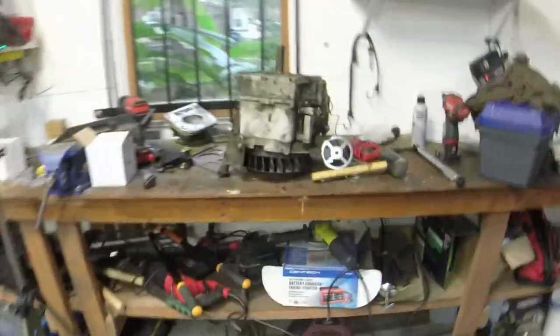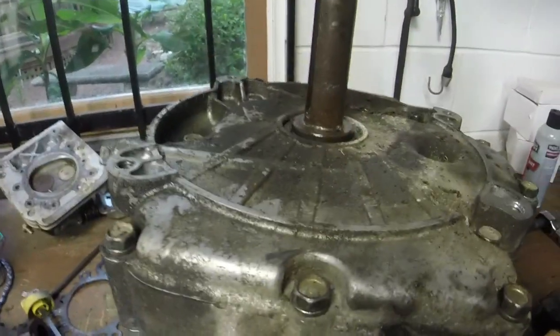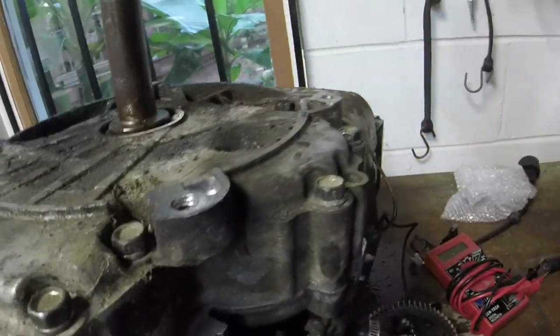All right, guys, so I did what I told you I was going to do. You just get the eight. Make sure the governor stays on that arm. Slide it slowly down. Make sure that your seal is good around your bolts, or around your sump, whenever you set it down. You can tap it with a little rubber mallet.